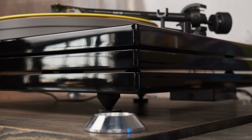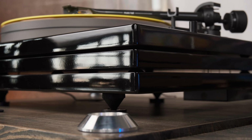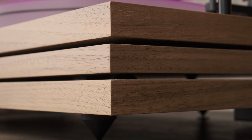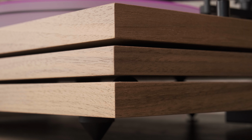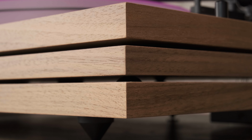We call them audiophiles. The main idea of the Music Hall turntables of the upper lines is the vibration isolation of the key elements of the player by means of separate plinths. In our case, these are 3 plinths, they are all made of MDF, and each of them is separated using Sorbothane spacers. Sorbothane is an ideal polymer for dampening vibrations. It's widely used not only in audio equipment, but also in medical equipment and even in the aerospace industry. So, in our player there are 3 plinths.